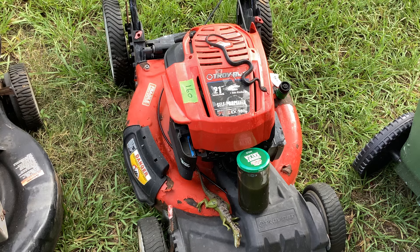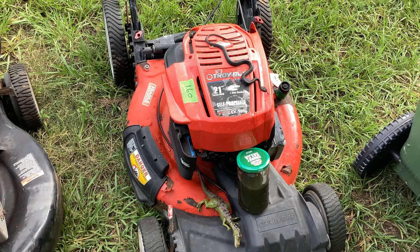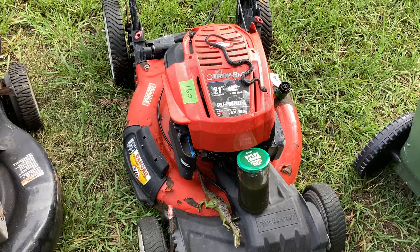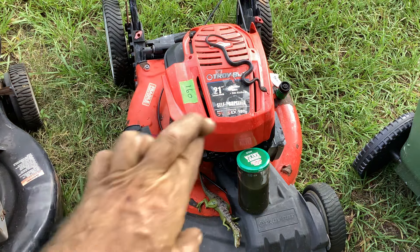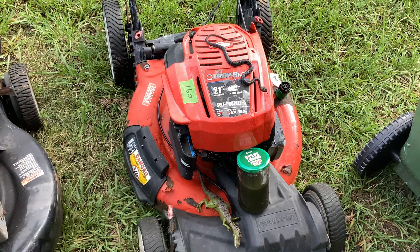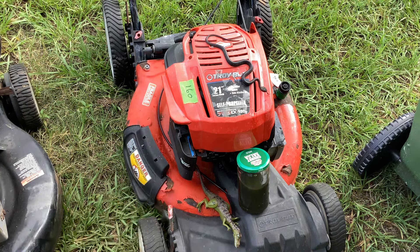This is the second edition of Saturday's video. I'm going to add more fuel to this — I had put some Marvel Mystery Oil in the first tank and it kept stalling, but I think we had what Dirty Bernie said was a rubber needle issue. Crossing my fingers that Bernie's right. I'm going to let this thing keep idling, and if it idles for more than 30 minutes without crapping out, I think it's a home run. We licked it with a carb change.